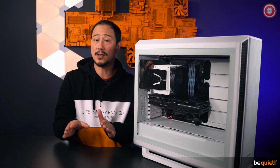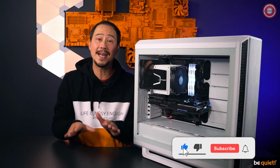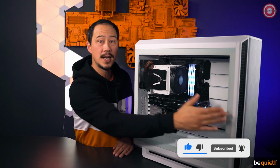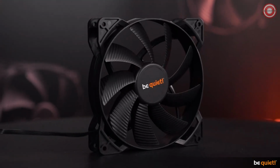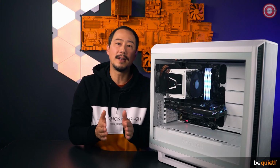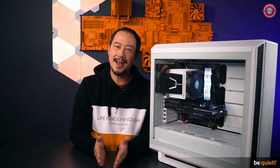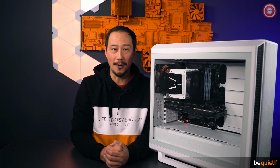If your PC is placed on the ground, for example, and if you use a water cooling system, you will observe a big net win in quietness when you use the mesh panel in the front and the closed panel in the top. Another option would be to use the maximum number of slow rotating fans in the case in order to create the perfect work environment for the air cooler as well as the graphics card. And that's just a few examples of many more.